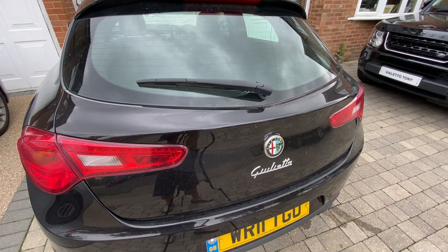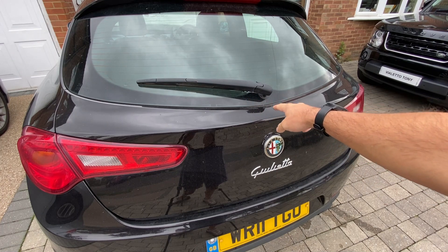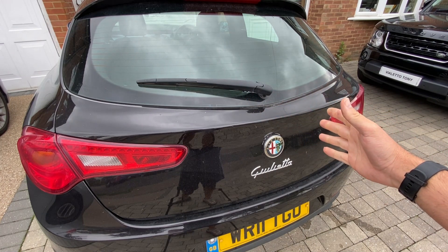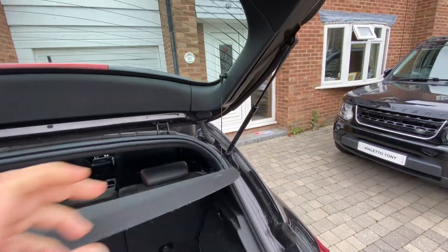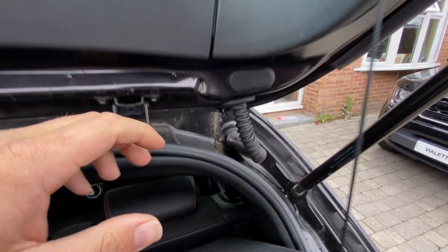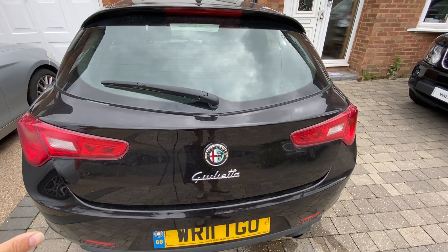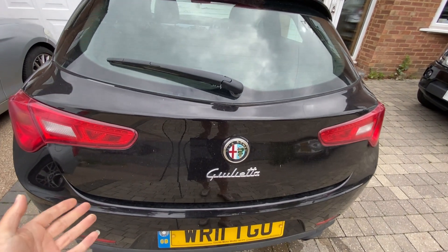With all the rain we've been having lately, even after changing the wiper seal, when I lifted up my boot the other day I noticed I could still hear water sloshing around inside. When I opened it up I could hear it just rush down and you can actually see it coming out the drain hole. So I figured what it should be doing realistically is when the boot shuts, be able to drain out down the bottom somewhere.